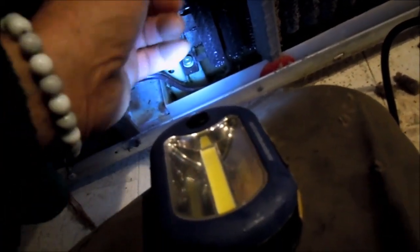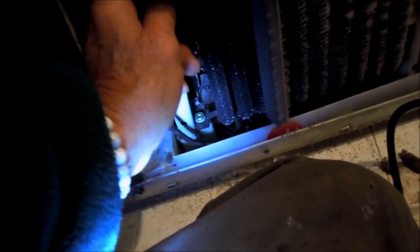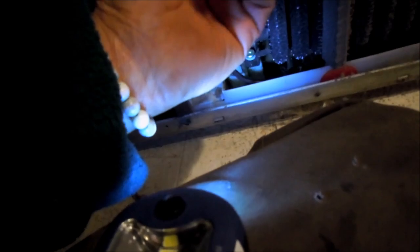You can see there is water in the defrost area — the defrost pan here. There's a little bit of water, which is a good sign. There are two drain tubes, one here and one there. The water down there indicates that these drain tubes are clear, but they're just frozen. Once all this defrost, we're going to have a lot more water in here. You can take these off and look at them, make sure they're not clogged. You can also run a coat hanger up through here. Then I take the heat gun — because it's pretty cold here — and heat up the areas where these defrost tubes go on the back, all the way up through the refrigerator compartment, so it clears any ice in the defrost tubes.